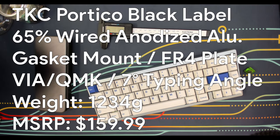Let's get technical. Today we built the Key Company Portico Black Label. It is a 65% anodized aluminum case. This one is the Bombay colorway. This does come in four different colorways: rose, obsidian, angora, and Bombay. It comes with an FR4 plate, and it is made with the gasket mounting system. It also includes PCB stabilizers by C3 Equals. It has a 7 degree typing angle, and loaded with switches and keycaps, weighs in at 1,234 grams. It has VIA and QMK out of the box.